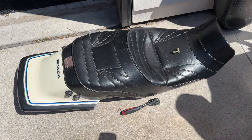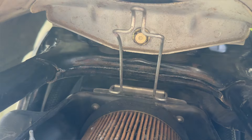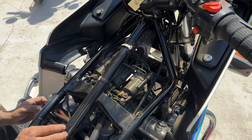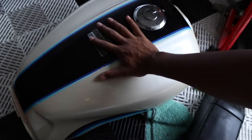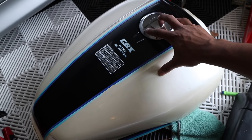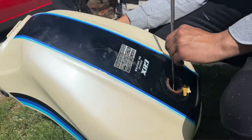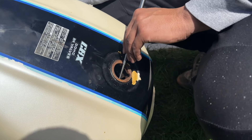The state of the gas tank was not very good. I had to take apart a bunch of bolts and things, and after everything I finally got access to the tank. Because this is a later model CBX with the fairing in the front, you actually have to take the rear part of the fairing off. There are a couple of weird bolts and you kind of have to feel it out. After getting the tank out, I fished out a ton of nails. The tank is actually sitting right here — I semi had it cleaned and we'll take a look at the inside in just a second. There was a ton of nails inside this tank and I spent a long time getting those out. After taking the tank off the bike and putting the battery on charge, I began fishing all the nails out.